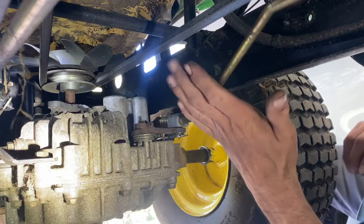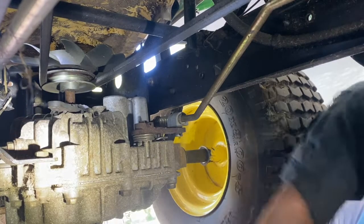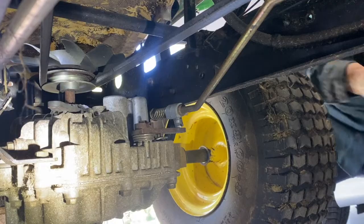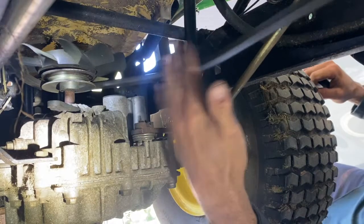The nice thing to do is put your brake rod here and take this clip off. There's a little washer to pop off there — take it out. Then energize your brake. Now relieve the belt. The brake is on and that belt should be loose.